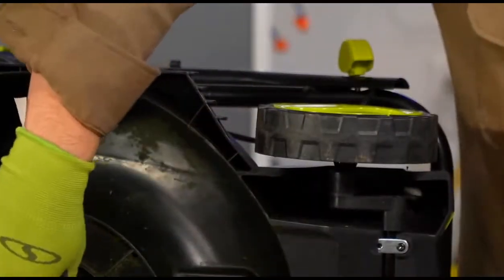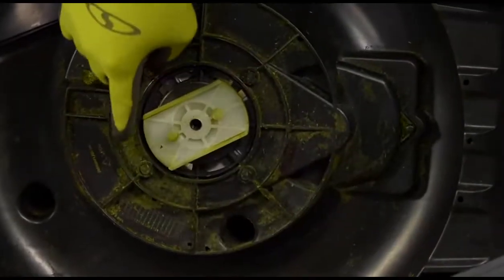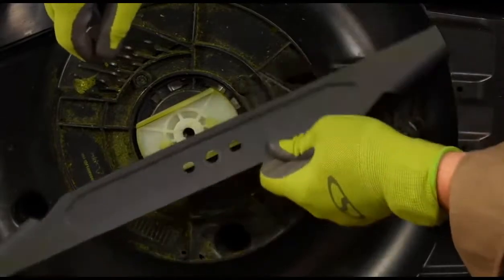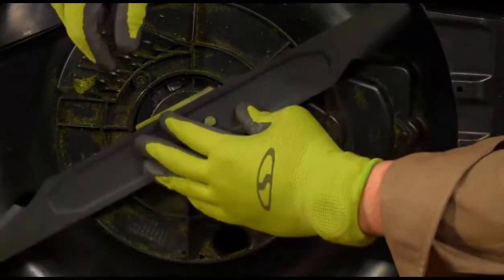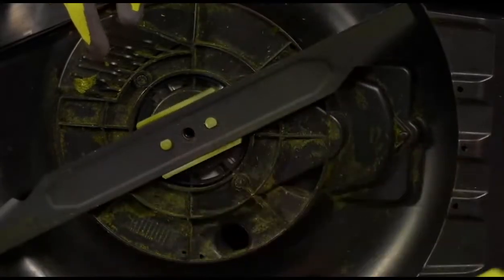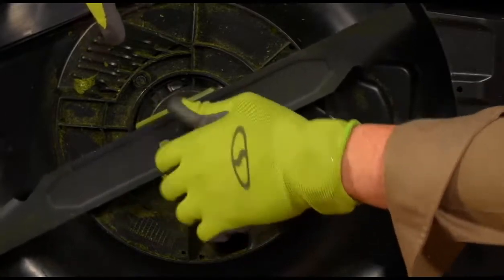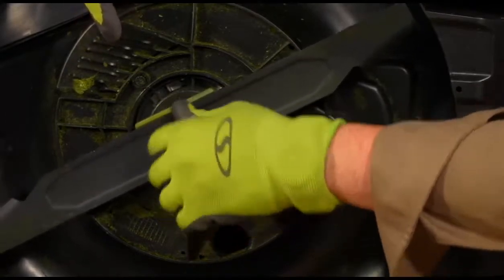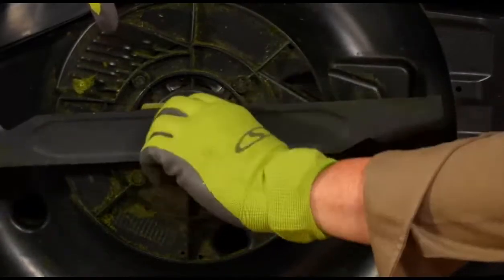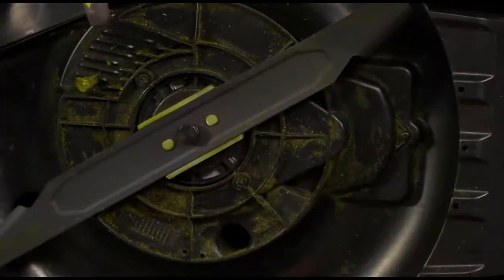So down over here on the locking piece right there, we can see that we have that nice directionality to it. And then we're going to offer this right up here just like that. And that's going to be how we lock our blade in. And that way we see our blade spins this way. So what I'm going to do here is throw in that nut. And here's another important reason that you want to wear the gloves. When you lock this blade in, you do have to grab the blade after you tighten this up here. Now, there's no need to get this massively super tight. You just want it nice and tight right there for that nut to really squeeze in here.